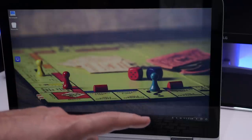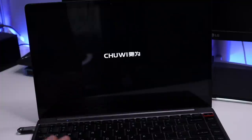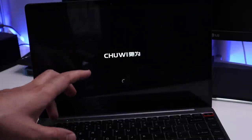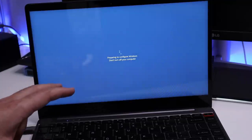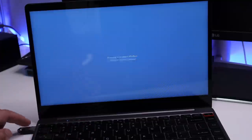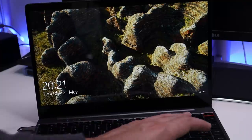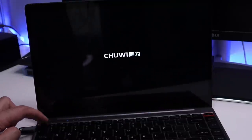Let's now try the other laptop - a cheap Chinese laptop. I'll plug in the USB stick first, then power it on. Like the other laptop, this is also running Windows 10 on the internal hard drive. Even though the USB drive is plugged in, this defaults and boots into Windows 10. How do we fix that? The two things we're going to change in the BIOS: first, make sure secure boot is disabled; second, change the boot order so this device always boots from USB first if it's plugged in. Let me shut that down and power it back on, pressing the Escape key to get into the BIOS.